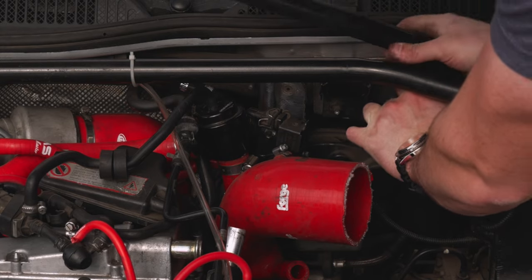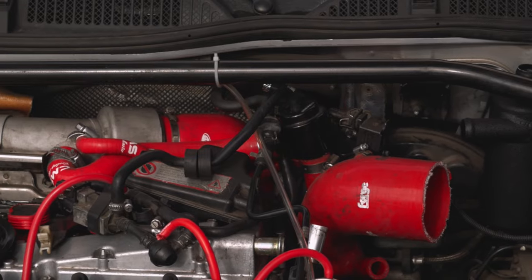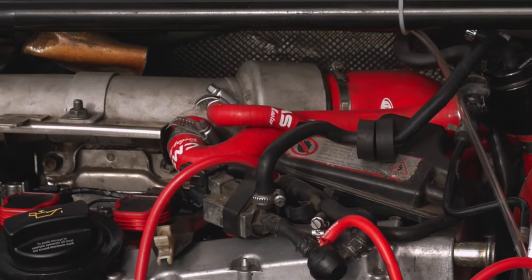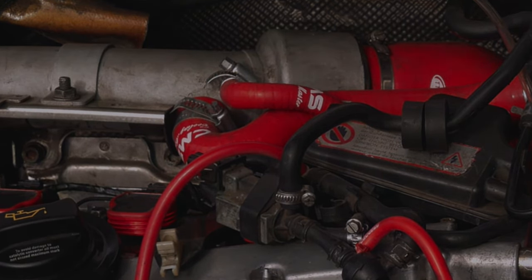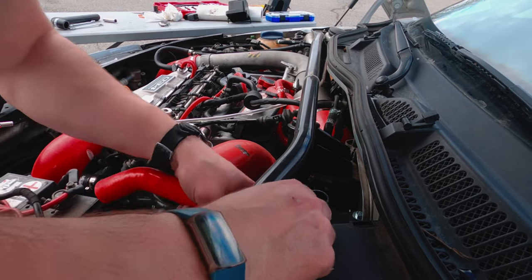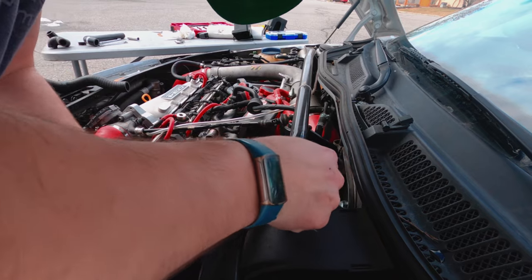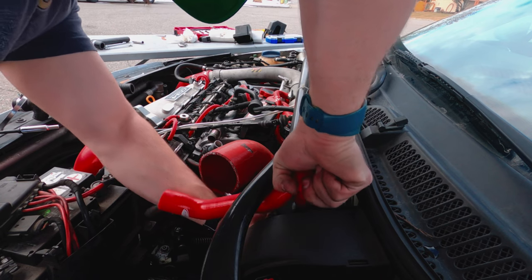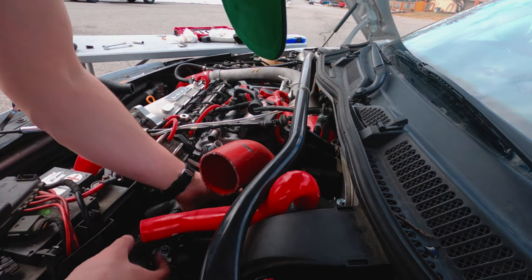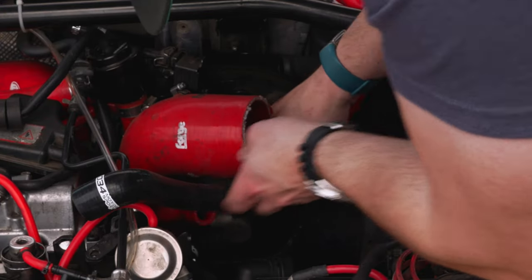Maybe it's not going to work. Maybe the only way is with a Frankenstein combination of many hoses. Or maybe the hose we've needed has been staring at us this entire time and is ironically part of this car to begin with. Turns out the only additional hose you need to make this kit fit is another 225 hose — the large one exiting the charge pipe specifically. That one has a 180-degree bend and it's the same size as the exit of the catch can, meaning it's coincidentally the perfect shape to get it to point towards the turbo inlet pipe. Furthermore, the outlet of this hose is exactly the right size to insert the 034 hose, so we don't even need an additional extension.